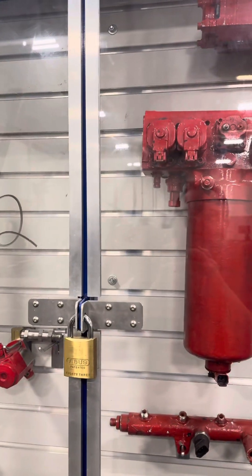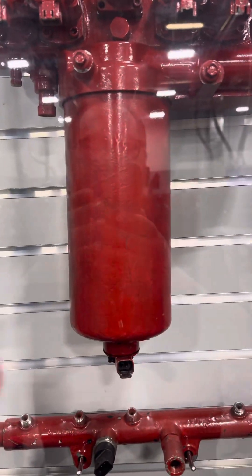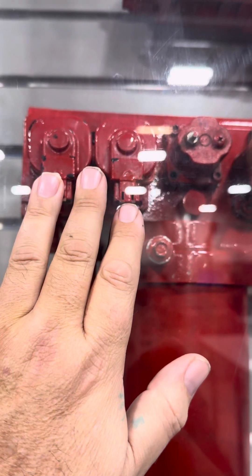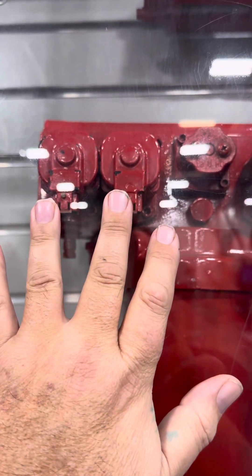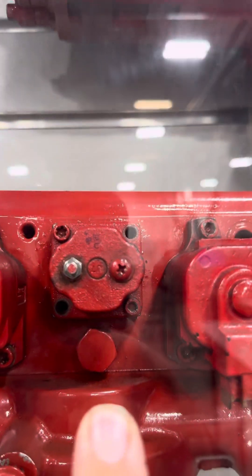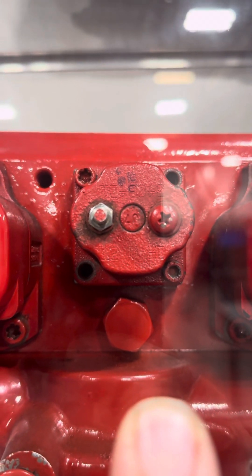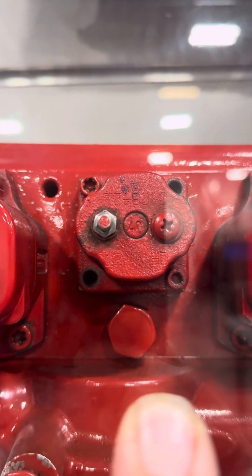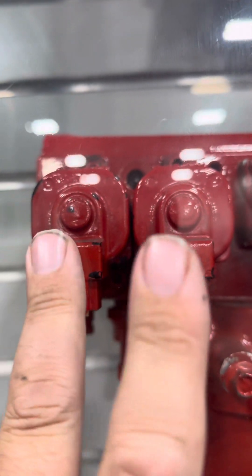I've got it locked up in a cabinet because I don't want people stealing it. If you look at the IFSM, you've got your fuel filter right here, and then up here at the top is where the electronic controls for that fuel system happen. You've got four components that look really similar, and then the guy in the middle — that's the fuel shutoff solenoid. The fuel shutoff solenoid is what allows fuel flow to go through this module and eventually to the injectors when it's energized and open with key on.